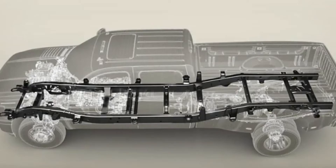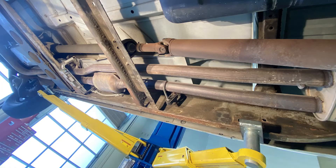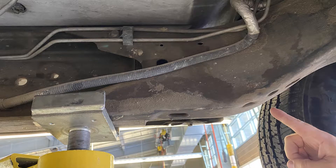On vehicles with body-on-frame, the lift points will differ. We will be lifting these vehicles using a point such as the rear differential or part of the frame, then we will rest the vehicle on the frame. We will want to make sure that this part of the vehicle is on the flat part of the frame before it slopes off.